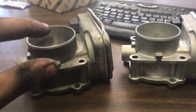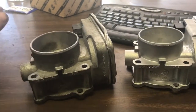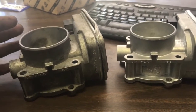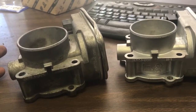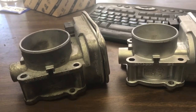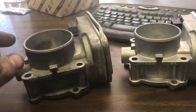It looks like a lightning bolt with two little lines on each side of it. The first indication that the throttle was bad — she was basically going into limp mode, so it wasn't allowing her to even accelerate or do anything. And on top of that, when she brought it to my shop, as soon as I would turn on the vehicle I would notice that it would start clattering.